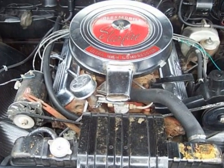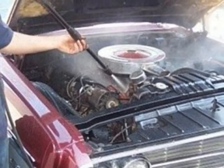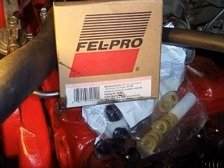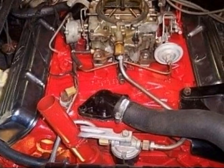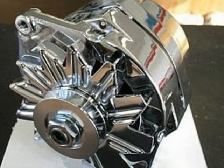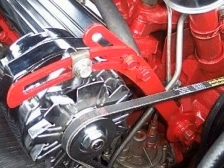It's time to finish work on the engine compartment. That means another power-washing and hand-scrubbing before starting in. We checked the engine over thoroughly, painted it the correct color, and added a new set of valve seals. Here's the engine with the valve covers replaced. The old generator wasn't producing enough power, and so we replaced it with a new chromed 100-amp alternator. New brackets had to be hand-formed to accomplish this.